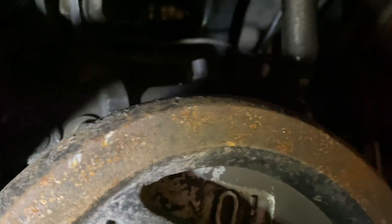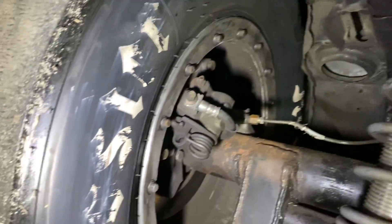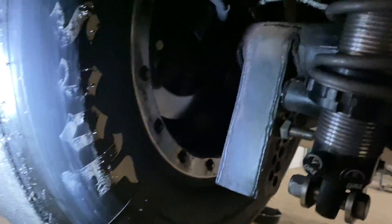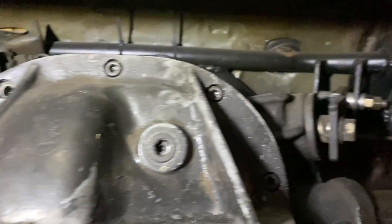I'm going to swap the tires from side to side. You can see they're feathering up pretty good from the tire spin, but that's normal with a set of slicks. We're not even down to the first set of wear bars yet, but these definitely won't last as long as the pro bracket radial. It might be one of those things where we change them out every 10 passes — gotta do what you gotta do.